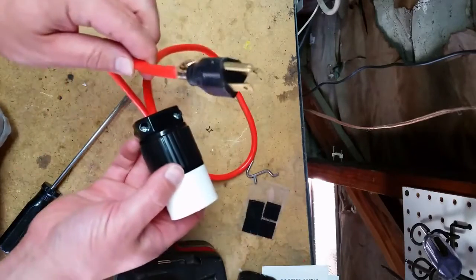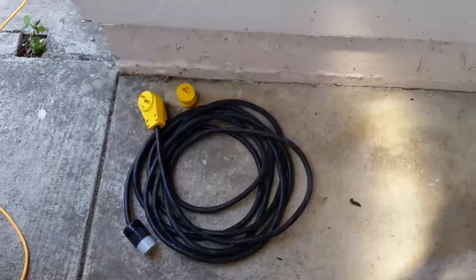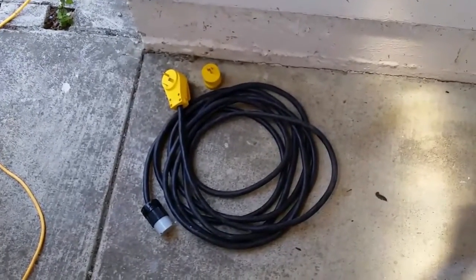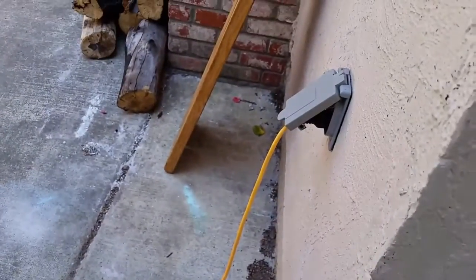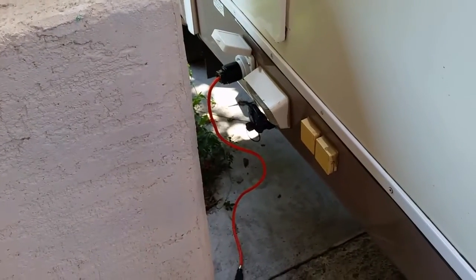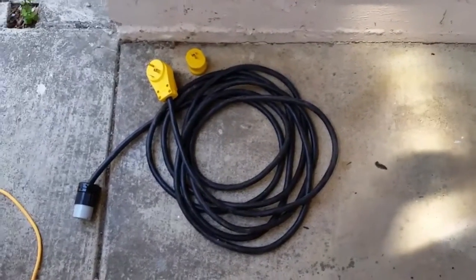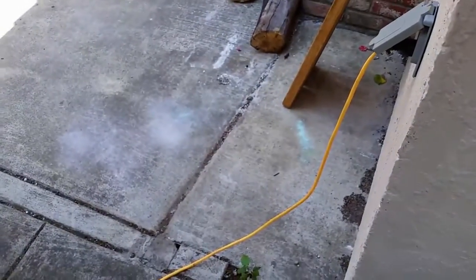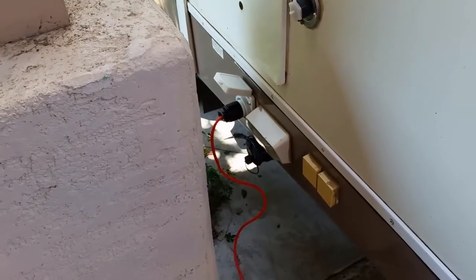That's it — one 15 amp to 30 amp twist lock pigtail. Here we are back at the RV now, and instead of having this giant pile of cord and the adapter, now what we're left with is our nice pigtail just going into a short extension cord up to the outlet. A lot less wire hanging out, less temptation for wire thieves, and less of a tripping hazard. To me it looks a lot better than having that big mess sitting on the ground next to your RV. Hopefully this will help somebody — if it does, please hit the subscribe button and give this video a thumbs up if you want to be notified of more videos and RV tips. Thanks for watching.